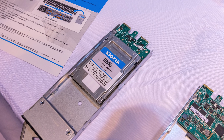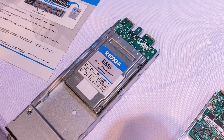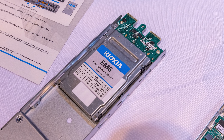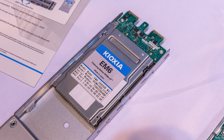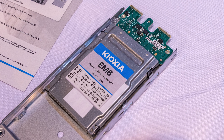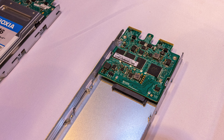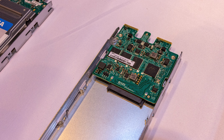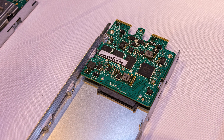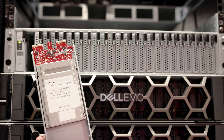Here is basically a picture of the drive in a sled. We have this EM6 drive, and then we have two connectors, which are actually EDSFF connectors — the same ones you'd see in E1.S or E3.S drives. There are two of them, which is really important when we look at the topology. There's also a little version of this that has space for a standard NVMe SSD. You can take a normal NVMe SSD, put it into this little Marvell controller board, and it will actually turn it into an NVMe over Fabric SSD.